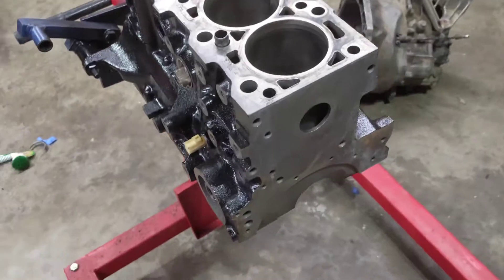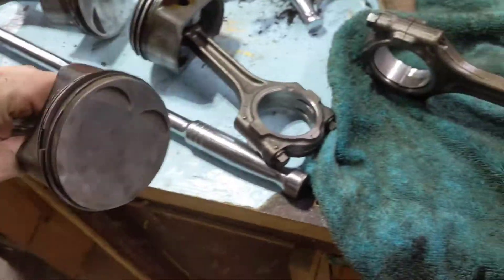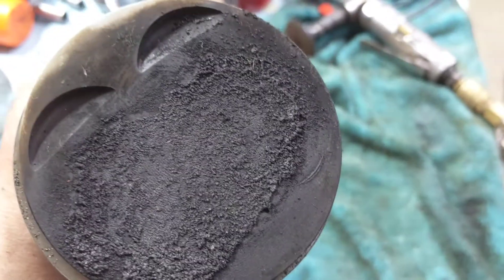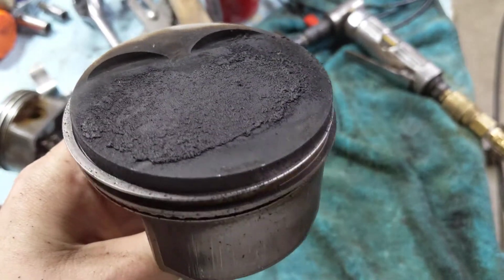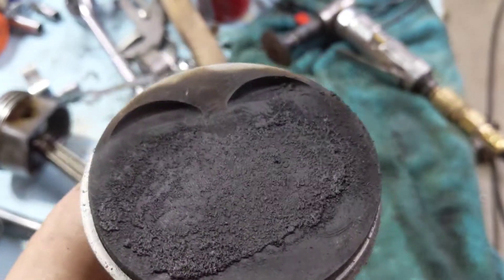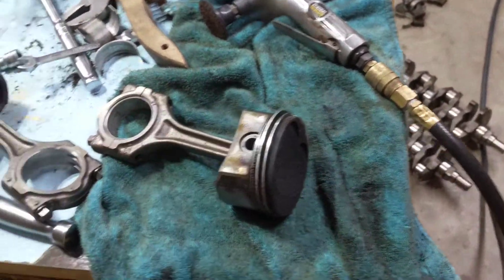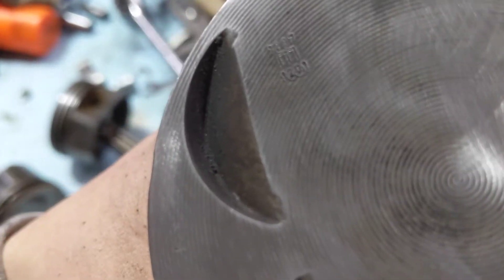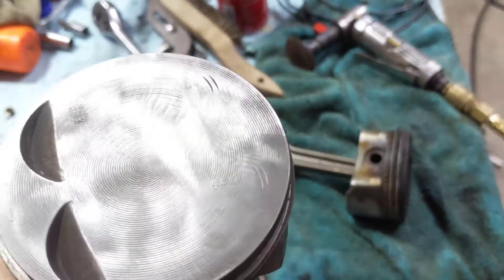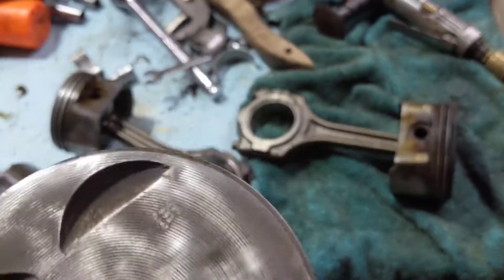It's unmasked and looks great — a nice fresh coat of paint. Next, I've been working on these pistons. The piston faces had a ton of carbon on them — you can see this stock piston that came out of the engine is just caked. I don't know how that wasn't creating problems, maybe it was. It's thick and really hard — I've been chiseling it off and using a wire brush with brake clean, plus an air chisel. We end up with a somewhat clean surface, though I still need to clean down into the valve reliefs.